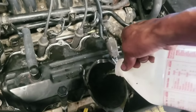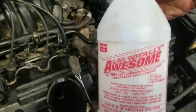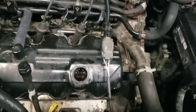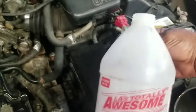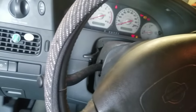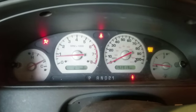Trust me and follow these directions — this is really going to work out. We poured the bottle in there, put the oil cap on. We used one quart of oil and approximately 64 ounces of Totally Awesome. We'll start the car up and start the process again. This is our second flush — the first flush we didn't use quite as much because we just wanted to break it up a bit. The oil light is off — see that? Because it's circulating right now.